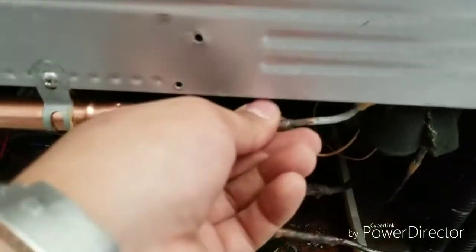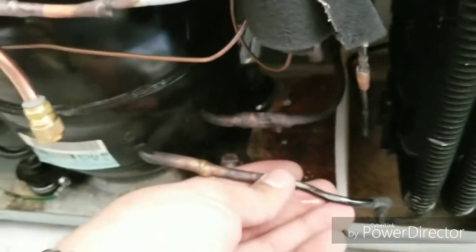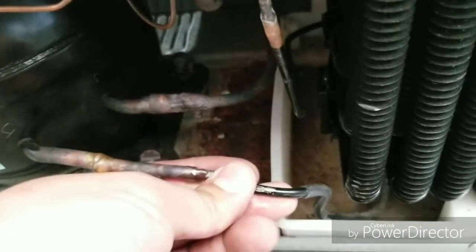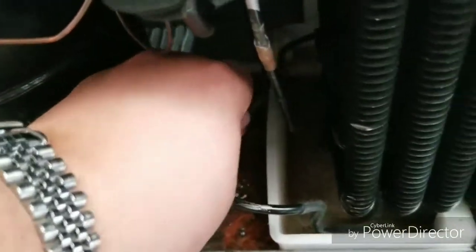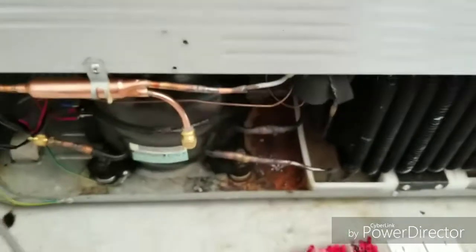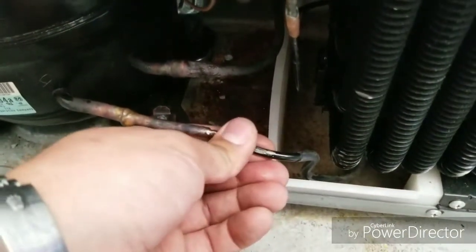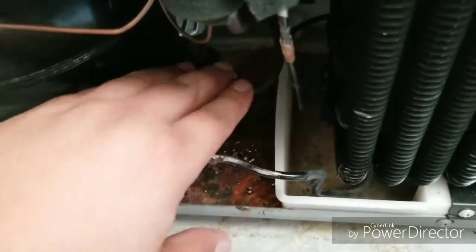The refrigerant is flowing. Let me focus here — this is my capillary return line. This is my high side and it's getting really hot; my cold side is cold right now. The condenser fan is not working because it's not hooked up yet — it's 16 volts in here. Right now I've got my compressor going: high side hot, low side is cold and getting colder.